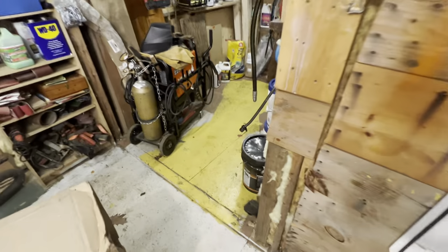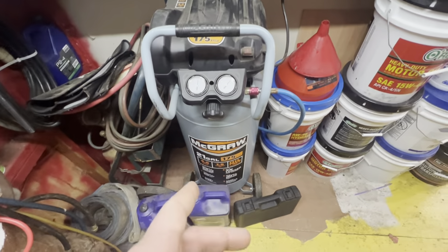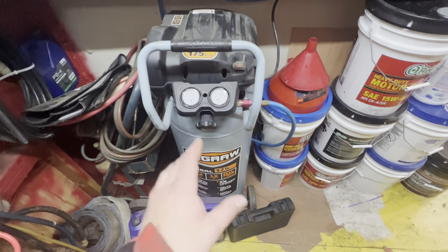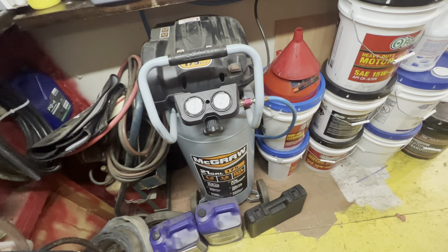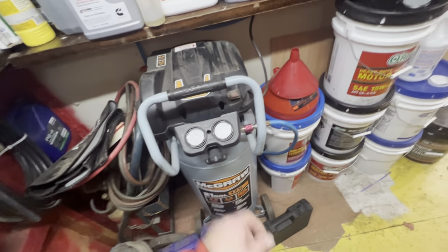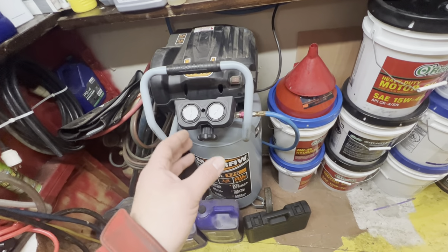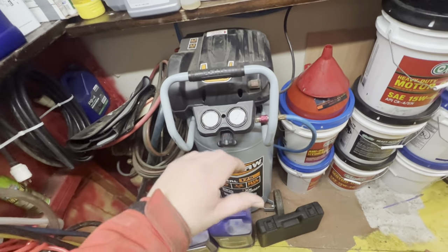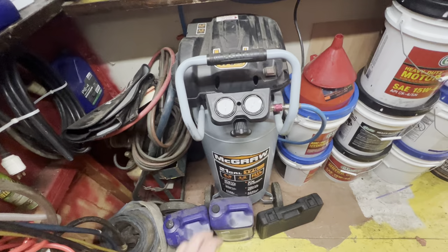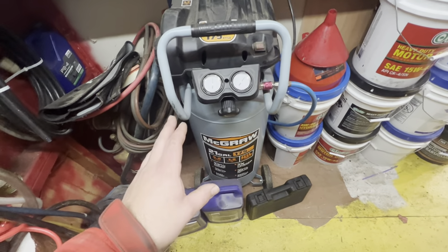Back to the compressor — I'd definitely recommend it. But if you're doing fluid film with a fluid film gun, especially on big trucks, it does not hold up the air volume you need. It has enough volume until about 10 minutes in, then the compressor has to run constantly and can't keep up. It does work, but you need to stop every so often and let it fill back up — then the gun sprays so much better.